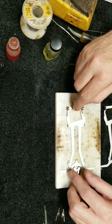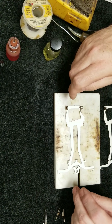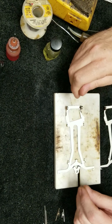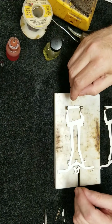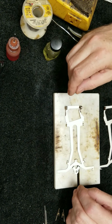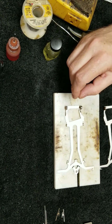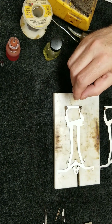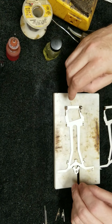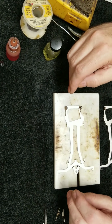Your second option bushing would be a Slick 7 machine type bushing, which is machined from a harder piece of bronze, or I don't know exactly. It's definitely got bronze, and I don't know what all's in that material. But with Slick 7 bushings, they fit nice and tight as far as the axle goes. But you have to keep them oiled every heat, because if you seize one of those up, you may have to cut the axle in two to get it out of your car. I do not use Slick 7 bushings. I've tried them in the past.